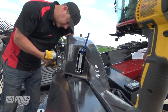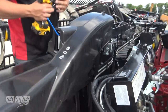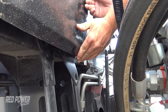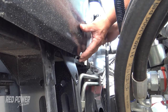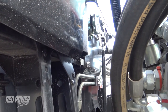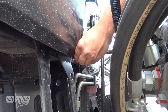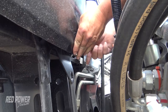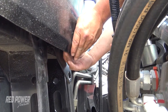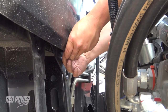We've got a 13. We've got that tightened. Now I've got to jump down on this side — we've got to put a bolt in. There's kind of a little insert here that holds that into place. You can see how the head of this bolt wants to pull through this cover. We're going to go ahead and put a washer on — one of the washers that came off our hardware when we initially took things off — and then we've got this nylock that's going to go up here on the inside. It slides up in a groove and kind of sits in a holder.